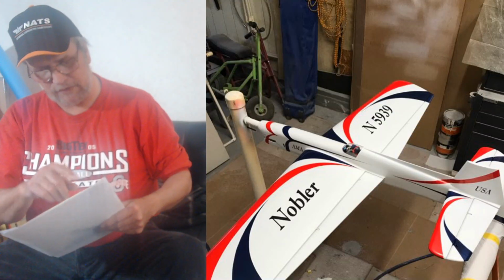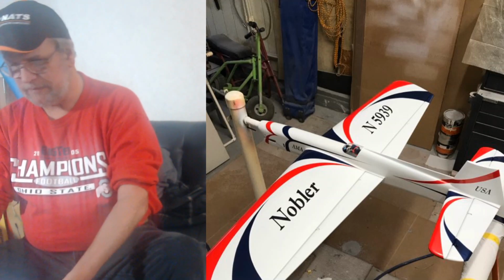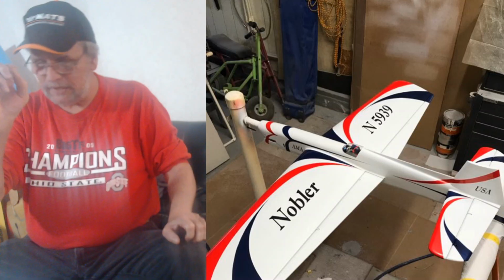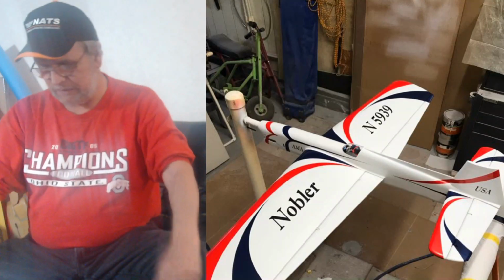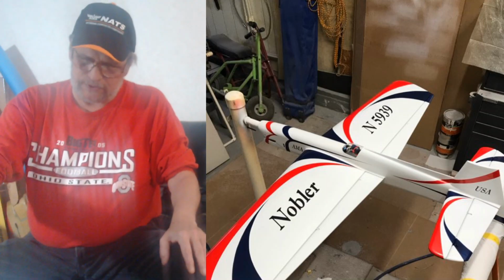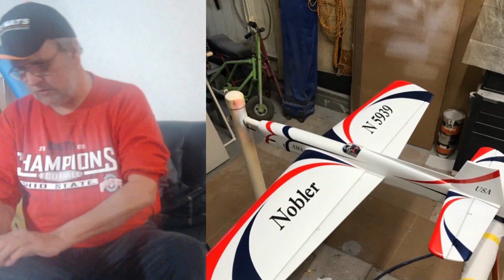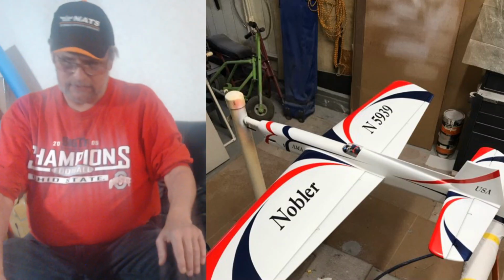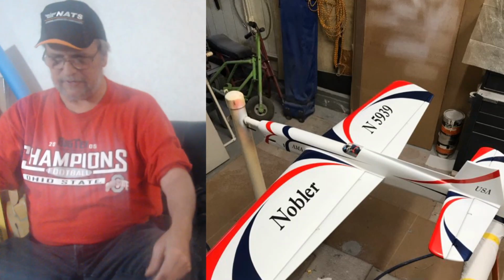It must be some dirty spot in the printer somewhere that's causing this to drag here. It could be a manufacturing thing in the printer, which might be a little teeny burr on something in there, or a piece of dust that's causing it to drag the colors down. It might be on one of the rollers. It might be a little piece of something on one of the rollers that it's going through after it's printed, and then it's got to go through those rollers to come out the machine. So it could be something on one of those rollers that's causing this, that piece of dust. It rolls through the wet ink, and then it smears it down the page because it's pulling it all the way down the page here. So that would be the first step I think I'd do.